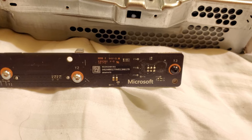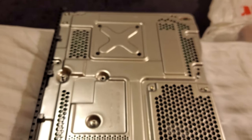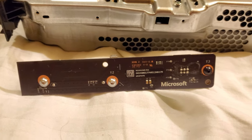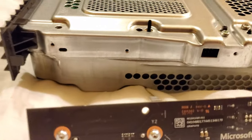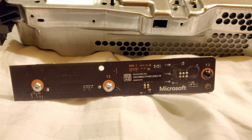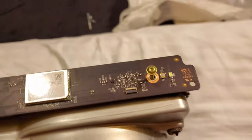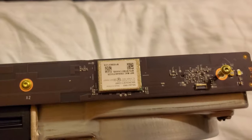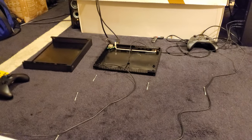There's this board — I'm not sure exactly what board it is, but it's a Microsoft board. With the console in this orientation with the X clamp stamp on the top side, put the board in this orientation with Microsoft facing upwards, and the black screw being in the far right. The board connects to that connector there. Then torque down the screws. For the Wi-Fi board, also orientated with Microsoft facing upwards, there are two gold screws and one screw sticking out farther. Hook up the cable that's going to be on the shell of the Xbox One X case.